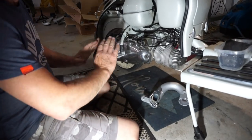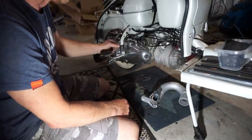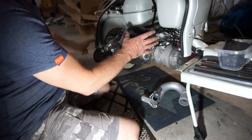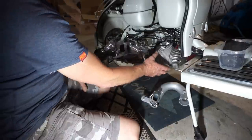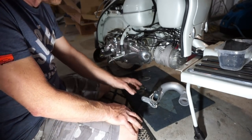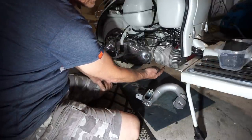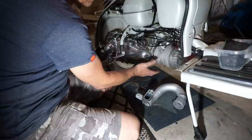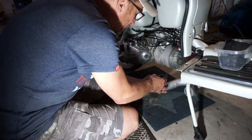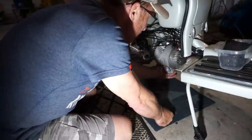This is now the fitting. What we've done so far is we've removed the old exhaust. To do so, we take off both floorboards and remove the shroud. Rear shocker off, and drop the engine down. That way, you slide your shroud off, and you get your exhaust off. Because this is a BGM exhaust, we've already put sealant and the gasket is on there — a brand new gasket with sealant already fitted on the barrel. Then we're just going to fit the downpipe straight on, without the shroud, because we can bend the downpipe around and fit the shroud in a minute.